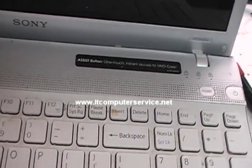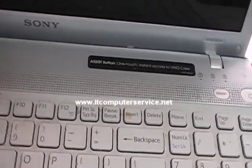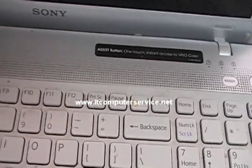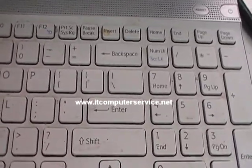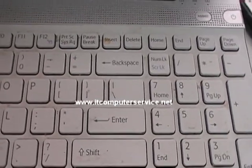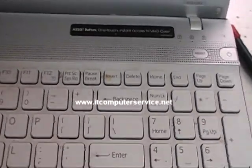When the laptop is actually dead — no activity — you turn it on, it turns on but there's nothing on the screen. The video chip is the problem, so you have to do the reflow on it. Subscribe and post your questions on the appropriate video. If the video helped you, please like it — until the next video!